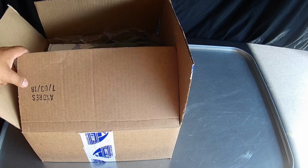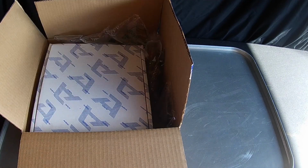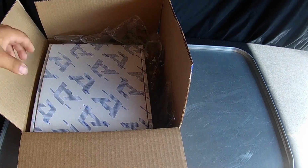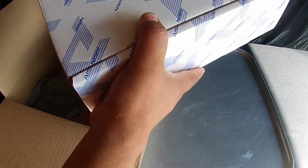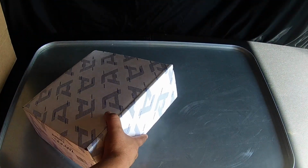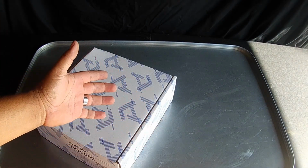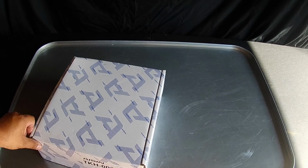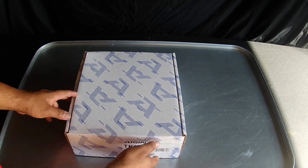So I just picked up this timing belt component kit from rockauto.com. It is an AISIN kit for a J Series Honda Acura V6. It's actually going onto a Honda Pilot, but I just want to show you guys what's all involved, what's inside of it, what kind of components, if it's a Koyo bearing, a GMB bearing, or the case may be.